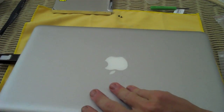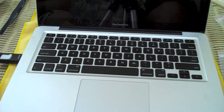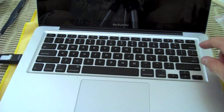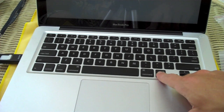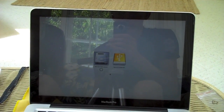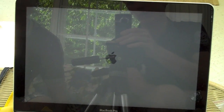We just got everything installed and the cover has been screwed back down. I've got OS 10.6.6 — Snow Leopard — installed on that flash drive, so we're going to see if we can option-boot into that. Holding Option, we've got a couple of different options. It found OS Snow Leopard on the USB, and then the hard drive has the Snow Leopard disk that used to be in the main drive. We're going to boot into the USB.